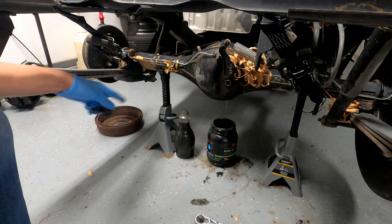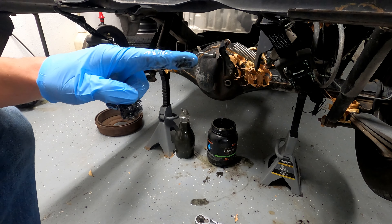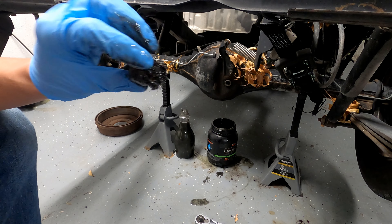I just pulled the drain plug out and it looks to be a broken differential. I put plates in the weld but I didn't have any gas — I figured this thing wouldn't be making enough power to shear the welds away from the plates, but I guess I was wrong. Good thing we have a spare diff right there. Going to get the axles pulled out, clean the entire case, get the diff out, weld the new diff, put it back in — actually use Argon this time — and get it all put back together.